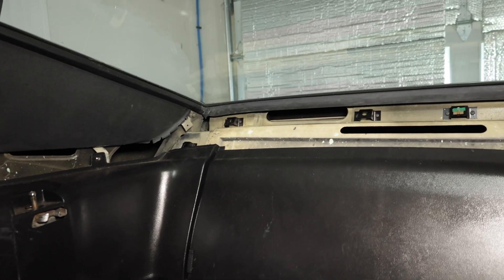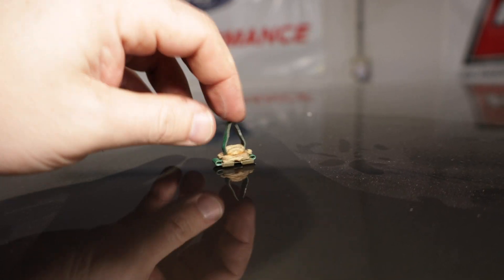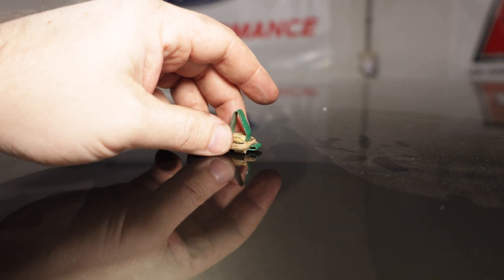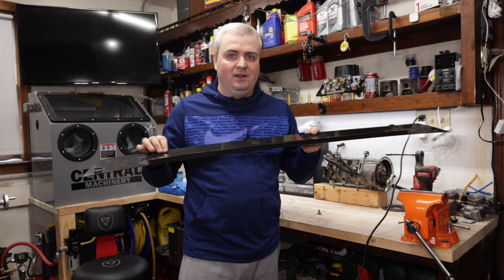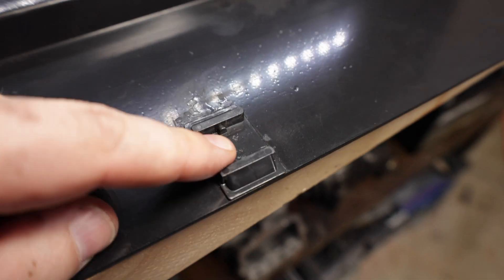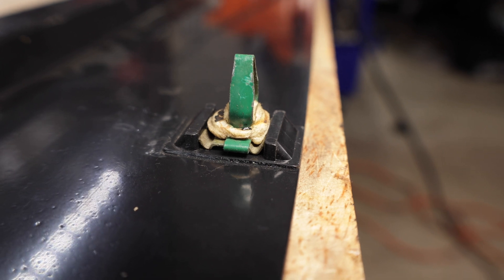From that angle, these push pins push into them, and there are six of them. So we're going to have to make something that goes onto those. Now those panels should be flat and they pretty much should just push in. Here's the clip that goes into that panel — it's just a clip with this little green piece in it. I don't even know if they reproduce these, so it's really hard to get. This clip essentially goes in, this piece connects into the plastic on the rear panel, and then this Christmas tree essentially gets pushed in. That clip pushes in this panel, and each one of those little brackets has six different places where it connects. Each one of these features has two walls and then a little protrusion right in the center that's supposed to hold it into place — if you push it in pretty hard, each one of those little lips will hold it into place.